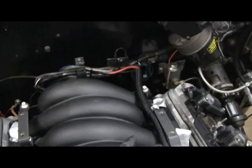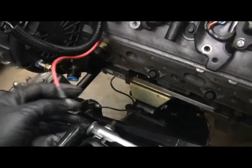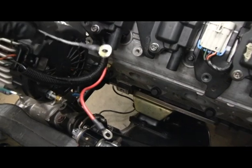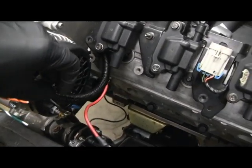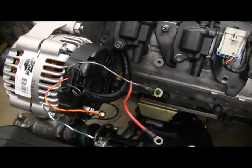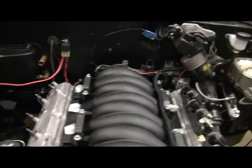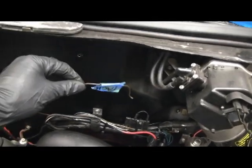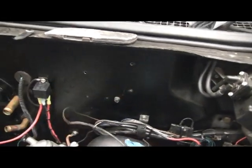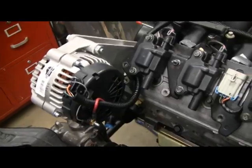I decided to use some of that corrugated wire routing loom here — brought it around, went under the coils, and here's the business end. The charge wire goes to the terminal on the back of the alternator. The S terminal off the plug also goes to that charge terminal. The brown L wire is inside the corrugated loom, and the other two I'm just going to tuck in there to get them out of the way. Here's the finished product — I'm pretty happy with it, came out really nice. The only thing left to do on the motor wire harness is the tach lead, which needs to hook up to the tach module. I'm not sure where I'm going to mount the tach module yet, so I'll hold off on that and fix the power lead for the computer. Other than that, it came out really nice and clean.